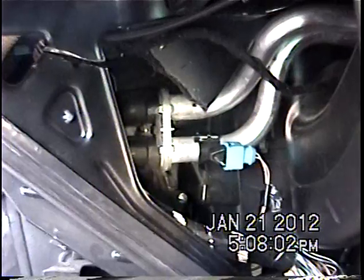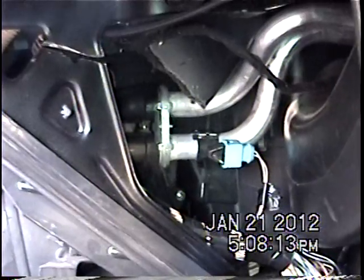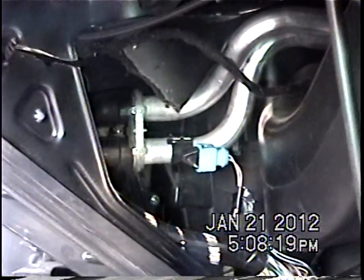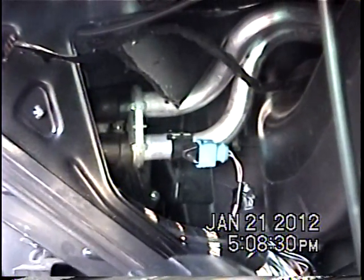So that's the joint that we need to unscrew, put the new seals on. It's held in by 1 screw that you can see at the beginning, the front of the 2 tubes. I'll point it out here in a sec. And I already did mine. Old seals were very hard and about 2/3 the size of normal. So after I hooked everything back up, there is no dripping. So that's kind of a neat thing. Looks like we cured it.